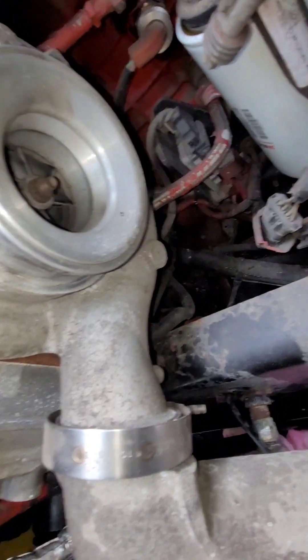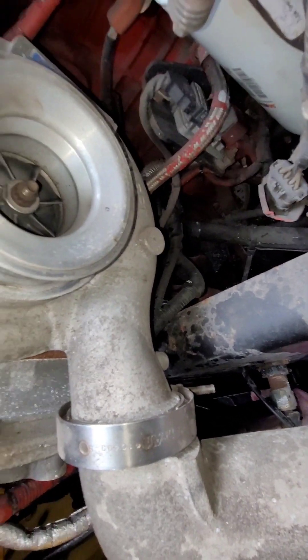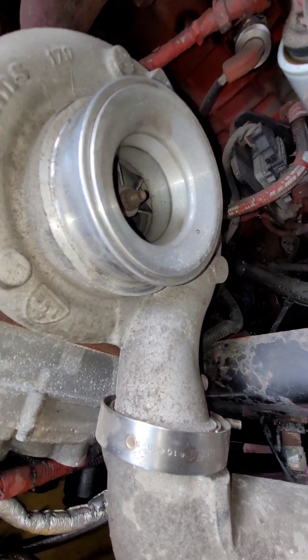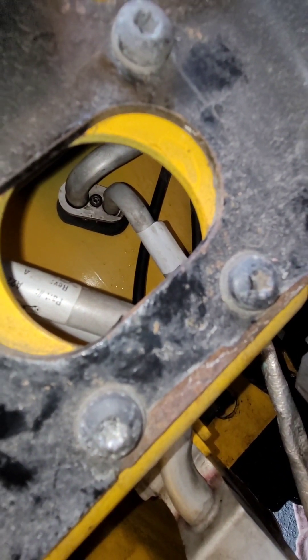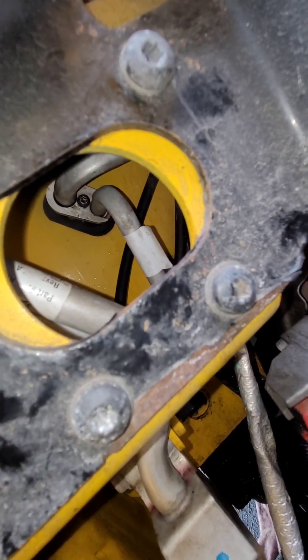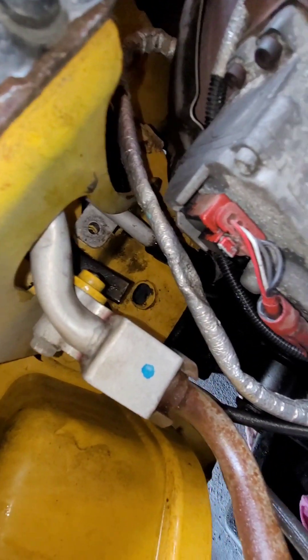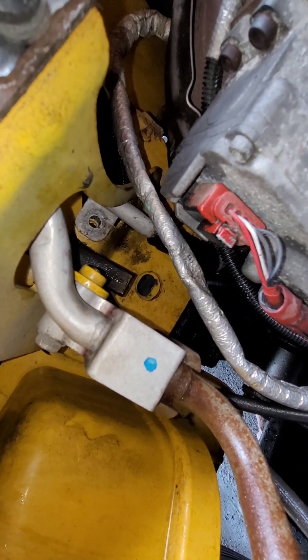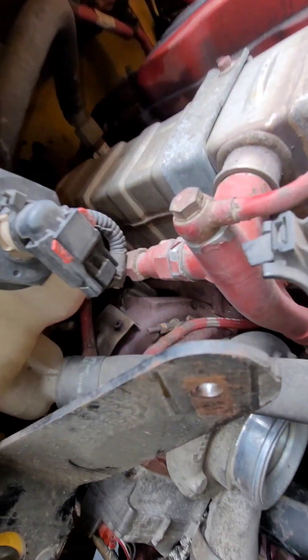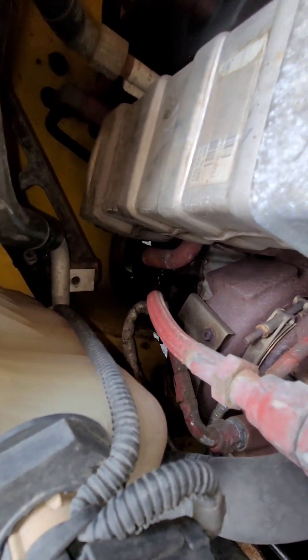This would be a good time to spray in there a little bit and clean up, or just wipe in there. The screw holding that on is a T27. For the pipes there for the heater core, a T27 will get it off. There's another one here too for the bigger hose, and that's off so it was easy to get them loose.